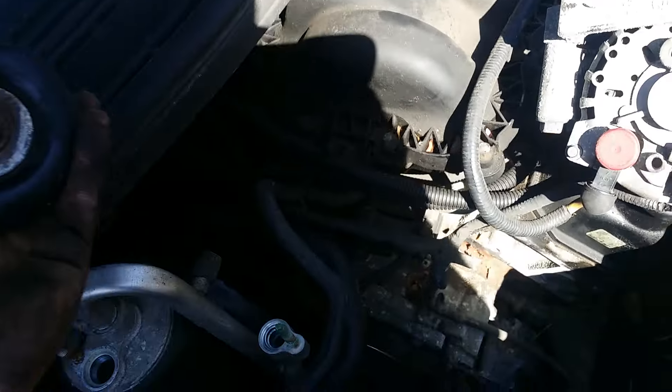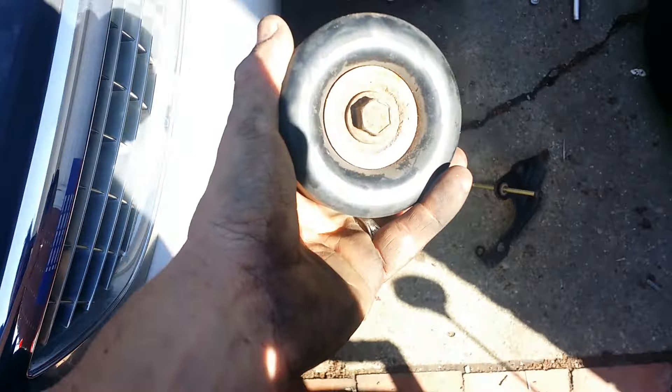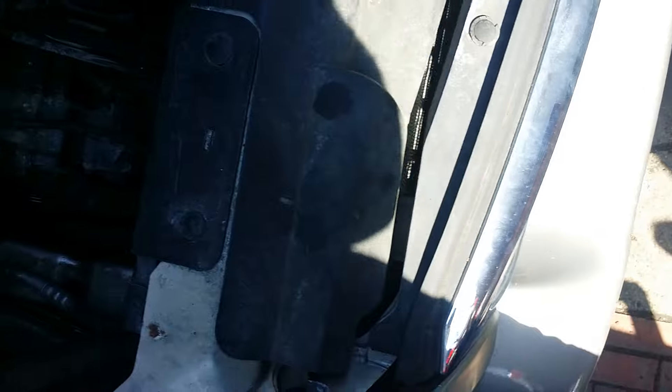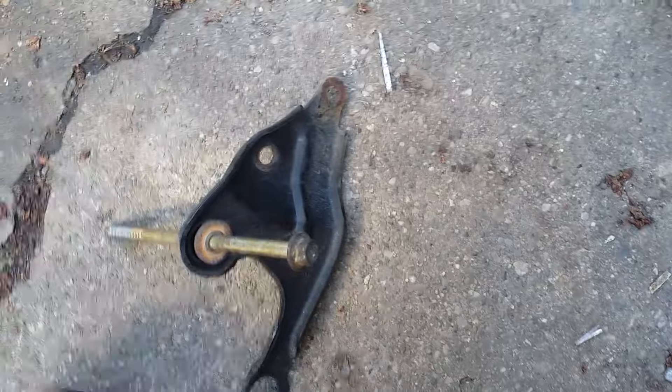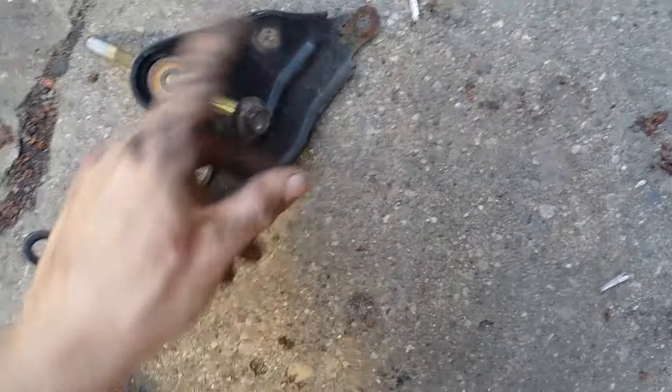The idler pulley was a 15. I basically had to leave it in there for a really long time even though the bolt was completely out, until the bracket was loosened. This bracket is held in place by basically three 10 millimeter bolts. I'm talking about the fastener tool sizes, not the actual thread pitch. There are three main bolts holding on the alternator bracket.